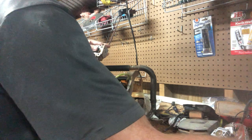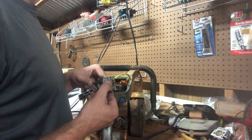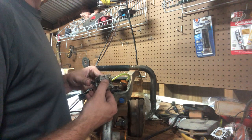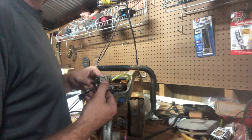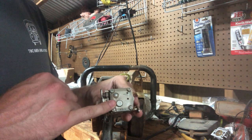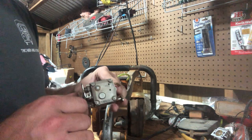You'll find that I make most of my own gaskets and/or reuse a bunch of gaskets. Mainly because when I put this all together, I use just your typical axle grease on the gaskets. It keeps them nice and pliable, helps with sealing, and you can reuse gaskets multiple times because they come off easy. So, back to this clone RWJ4 carb. Yes, I stole a genuine Walbro top plate off that other carb that I showed y'all. I will be swapping them back over.